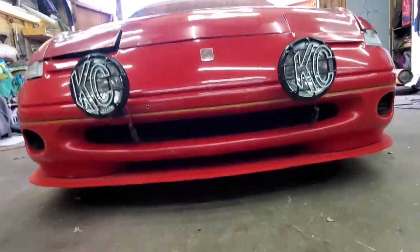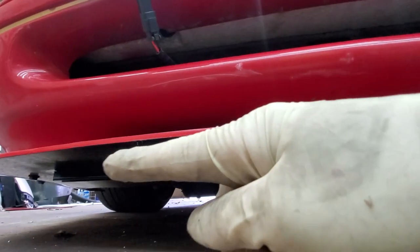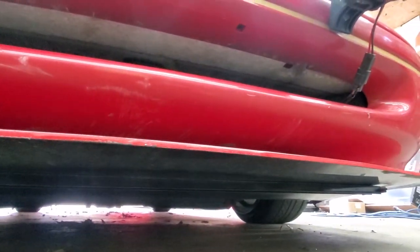All right, guys. Well, I just pulled the car in, got it up real quick, and got it all fixed up. And now, if you can tell on the video, it's nice and straight. The only thing I did was take a piece of aluminum U-shaped material, go across the bottom, and just rivet it on, painted it black really quick. Now it's nice and straight, and I don't think I'm going to have a problem with it sagging when it starts heating up, so that's good. Now I'm going to pull this out, and we're going to get Scotty's car back here and start working on that.